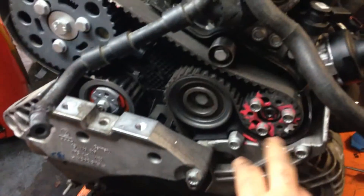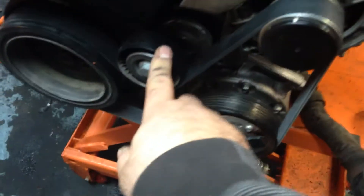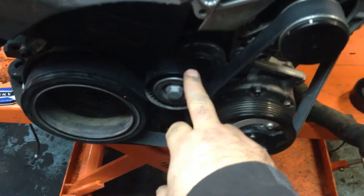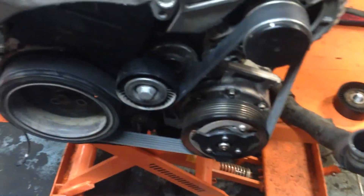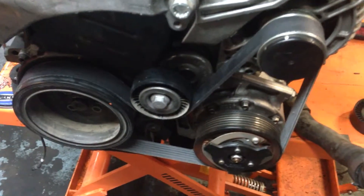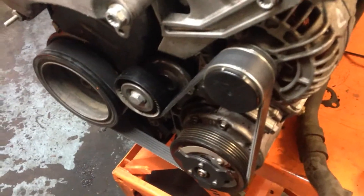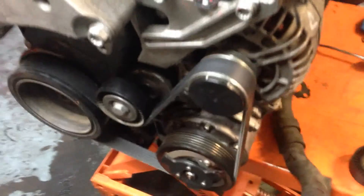All these pink notches were done by somebody else before the engine came in. This car has 117,000 miles on it, and the tensioner pulley was a little noisy, so we got a new one from a guy down the street. They are expensive — I bought a used one off a motor that had 10,000 miles on it for 20 bucks, but I believe retail with the tensioner is around 60. Just don't skip it because it is loud when it goes bad.